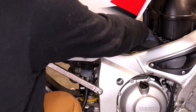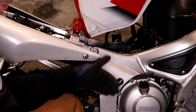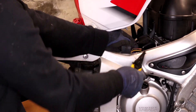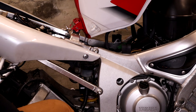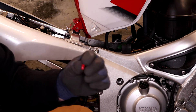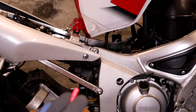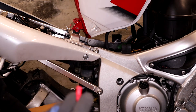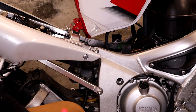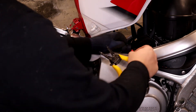Strip the cover back a little bit and strip the wire — there's one, there's two. In this case, female fittings. I want to stress — before you install something like this on your bike permanently, because these are going to get crimped on, you do want to test that they fit the connection you're putting on there. I've already done this. They actually fit very tight; it was hard for me to get them off. I think that's a good sign. It helps to squeeze the connector when you're trying to install them.